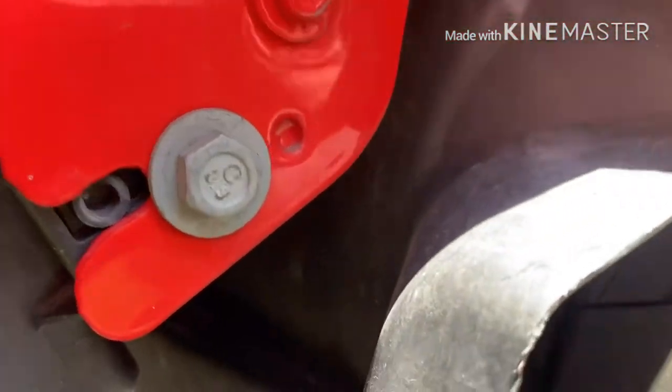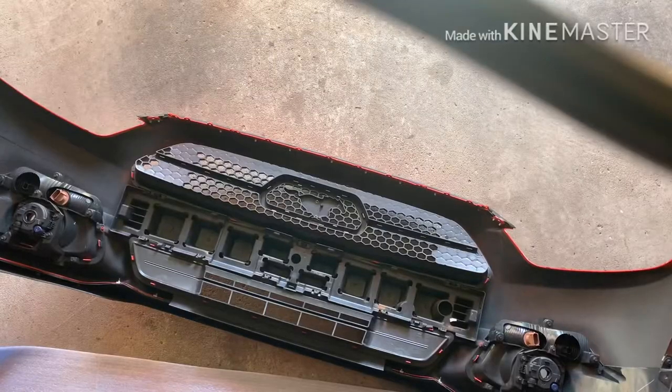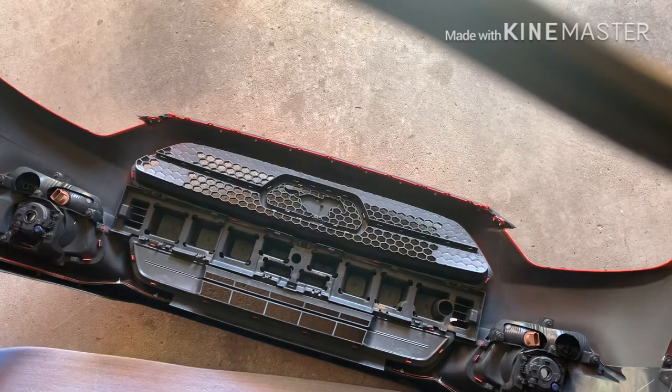Here's a piece of the bumper right there, jammed in there. After the bumper's off, there's just a bunch of seven-mil bolts to take the two fog light housings off. It looks like the lower and the upper grills just kind of push in — we'll tackle that next.